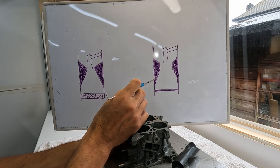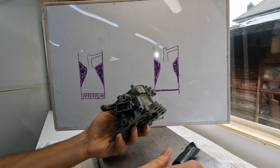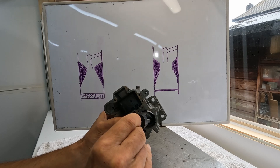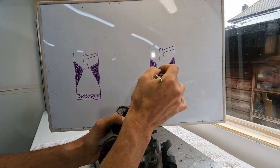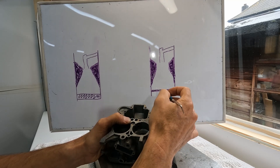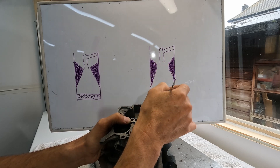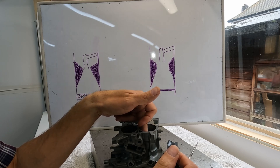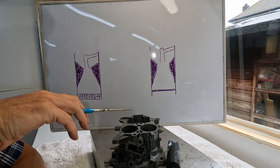What I'm going to do is illustrated here. First, I'm going to use this rather large drill to drill a larger hole in the secondary, essentially making a larger venturi so that more airflow can get through. On top of that, I'm also going to make the throttle plate thinner, meaning even more airflow at maximum capacity will be able to flow through this unit. I'm concentrating on the secondaries, though the same principle applies to the primaries as well.